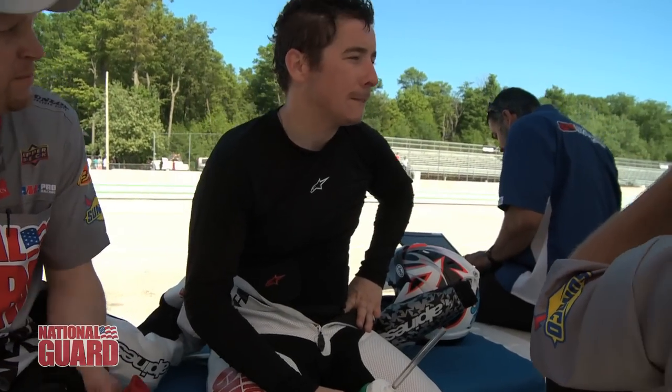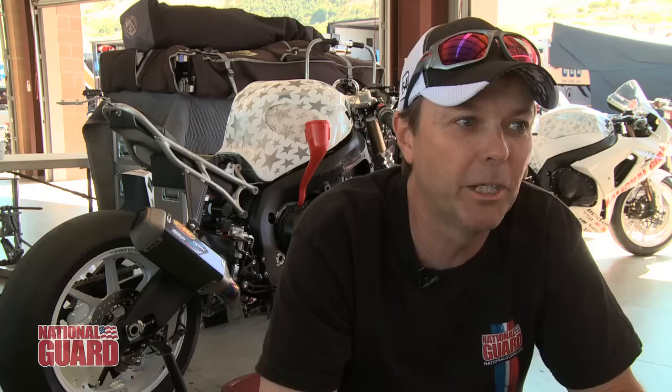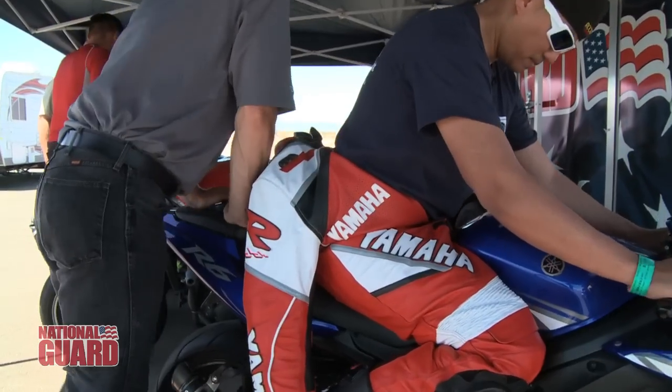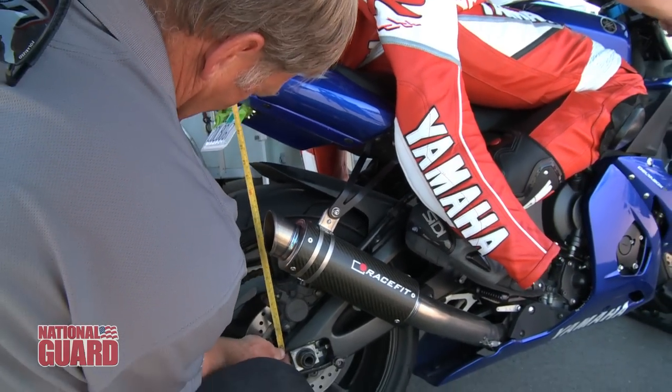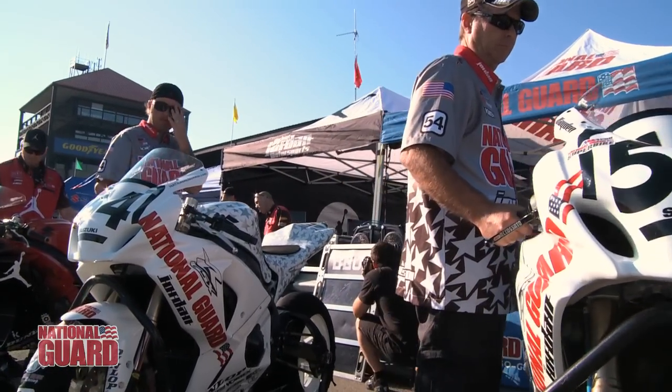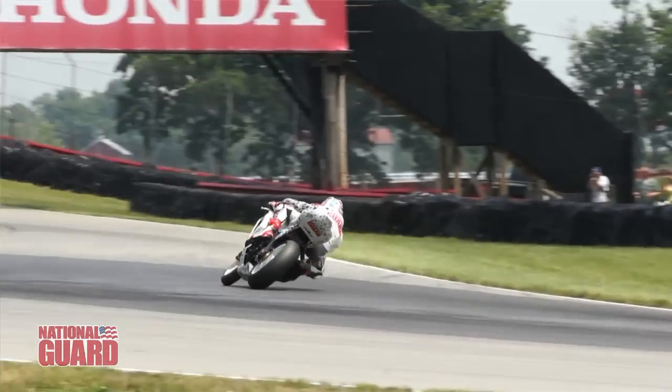We don't do so much sag at the racing level because most of our changes are done through mathematics and geometry changes. But your street guy can measure the bike unloaded and with a rider to set the preload on their suspension. These guys are so tuned to their bikes that the slightest changes they'll notice — whether a bike isn't turning in, is running wide, or isn't stable in a straight line. To a professional rider, these small changes are very significant.